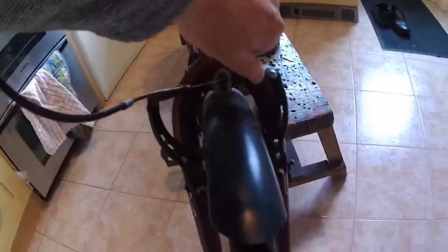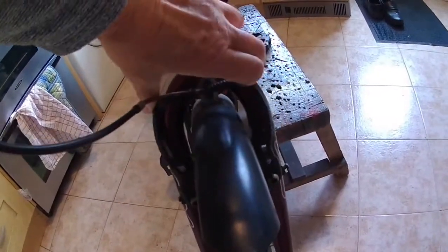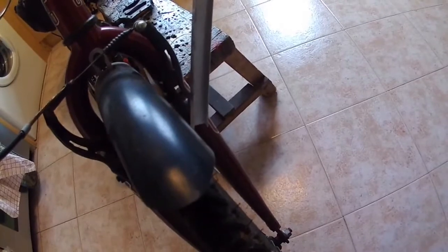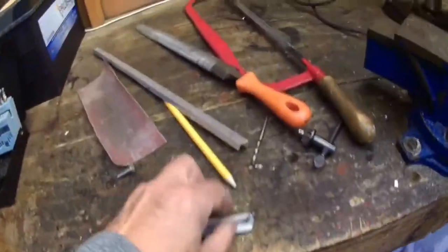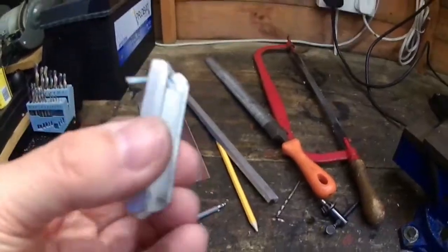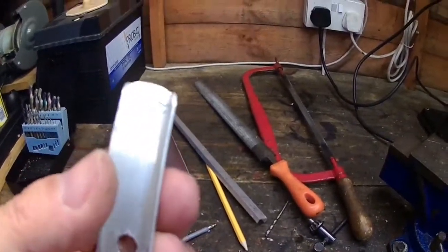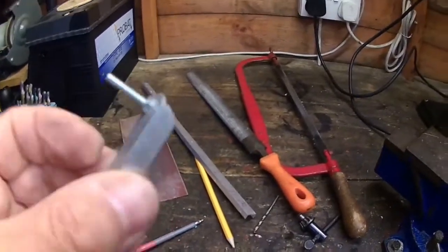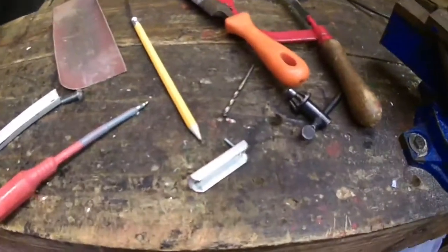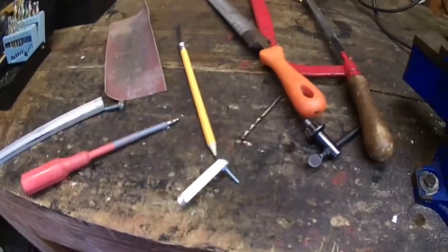So I'm going to apply reverse logic — I'm going to limit how far they open, like a limit stop on one side so that one doesn't go out too far. That's how I'm going to approach it. I'm very limited on the metal I've got to make some brackets — like an end stop — and I've only got this stuff. I've just fabricated this bracket and now I need to make another one because there's a left and right-handed version for the brake pads.